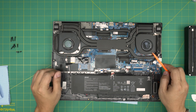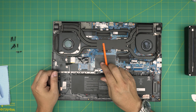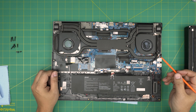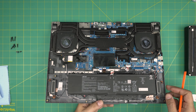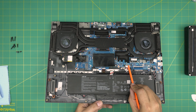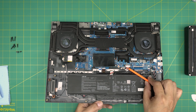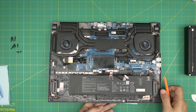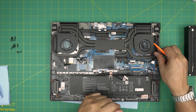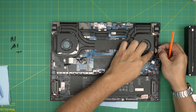Right away you can see the whole cooling system — there's the CPU and there's the GPU. First, disconnect the battery by pushing the metal cover toward the back about one millimeter only, then stick the plastic spudger underneath the jack, twist it, and it will release the battery. Now we're going to remove this tape right here.